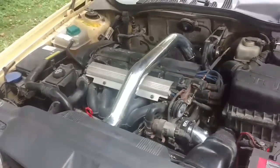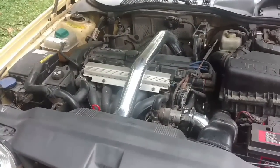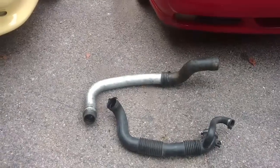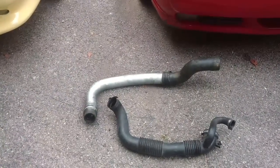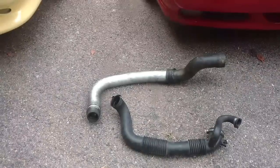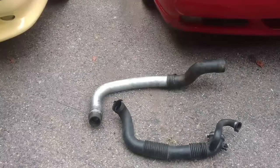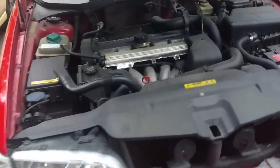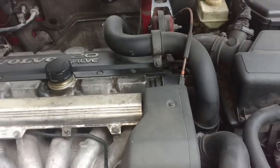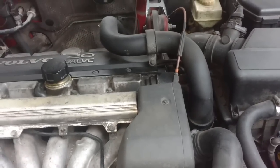It's reversed from how it was primarily used from 1994 to 2000 in these P80 cars. Initially in 1994, when Volvo introduced the T5 850s, they came with this version of the RIP kit. It immediately started having problems with freezing throttle bodies in extreme cold weather, so they recalled it and went to the intercooler piping you see here. They also put a hole in the bottom of the intercooler so that it could get rid of condensation and oil.